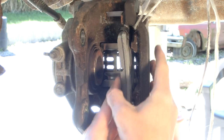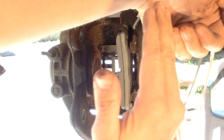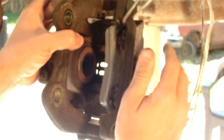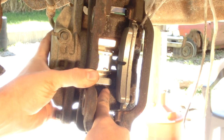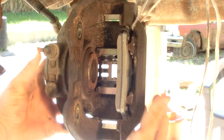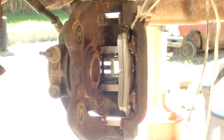Those two spring shapes — they push in when you press the brake pad onto them and hold it tight. I was trying to push the pad on when those springs weren't all the way in, so it kept hitting the side. I had to bend those springs back, and now this pad is seated all the way firmly against the caliper. This is actually the outside pad — when this caliper mounts on the rotor, this faces outward. Now we're going to put on the inside pad.